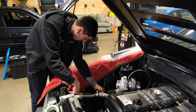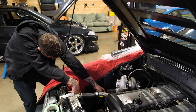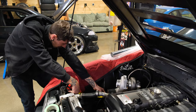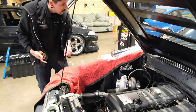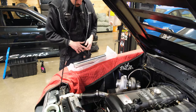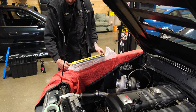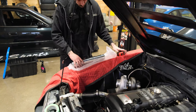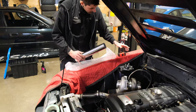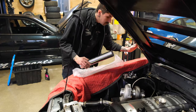I usually take off a quarter, 3/8, so even half. Because again, we're really close to the lip in there and you want room to move the pipe in and out. So we can go 14.5, 14.25. Our longer pipe that we have here is pretty much 14.5. So we can even just try and shove this whole one in, but I think we're going to get into the scenario where we still need to trim a little bit of tube.